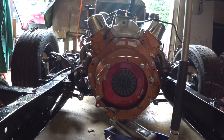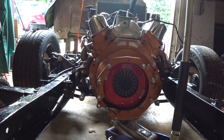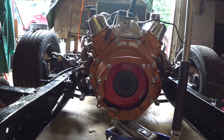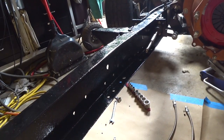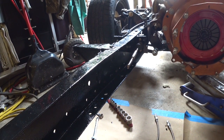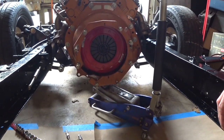So the next thing is clutch installation, transmission installation. And actually the order matters in this case. We've got our transmission crossmember that comes across here, and I want to bolt it into the bottom frame rail, which means I need to drill it, which means I really don't want the brake system in my way. Brake system normally mounts right over here, and it would be all in the way if it were in there for drilling that transmission crossmember. So we're going to go ahead with it.